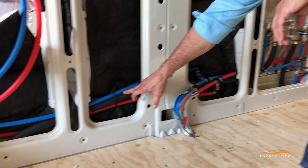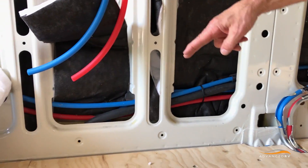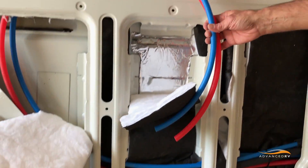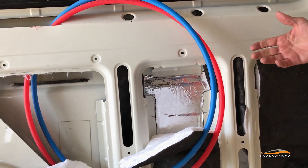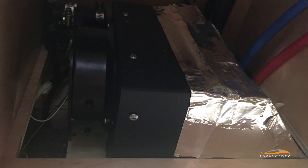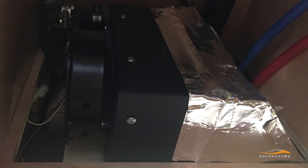The glycol runs right with the plumbing inside the insulation, all the way to the back, where the glycol comes through the floor. This plumbing goes to the bathroom — hot and cold — for running water there. The glycol then goes under the chassis, heats, and comes back up through to a furnace on the other side. That furnace uses convective heat to heat the chassis. We also sometimes put a second forced air furnace in under the sofa bed. The glycol from there heats the fresh tank and goes back to get more heat from the diesel-fired furnace.